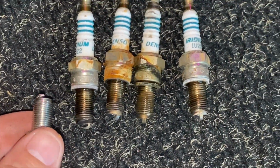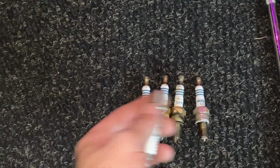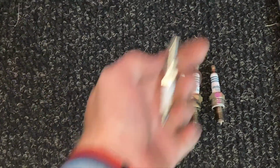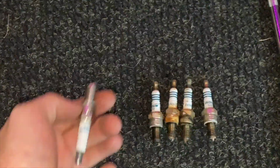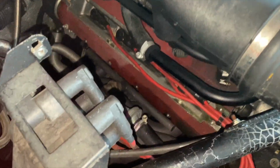So definitely a lot of water getting in there, but I think the misfire was actually caused by the middle plugs filling up with water and getting between that and the plug wires. So I'm going to have to get a bottle brush and scrape around inside the plug wires a little bit, but next step is throw these in the cylinder heads and tighten them down. Well, plugs and wires are back in.